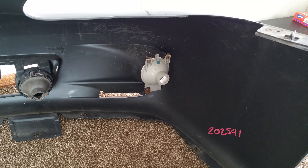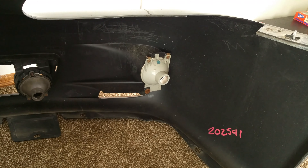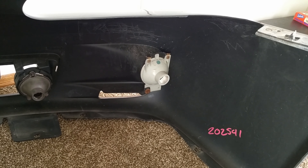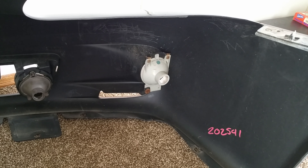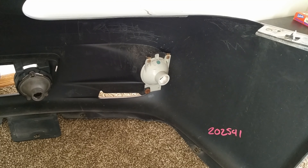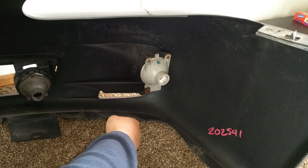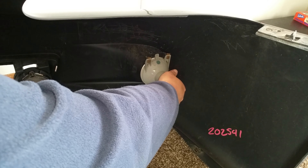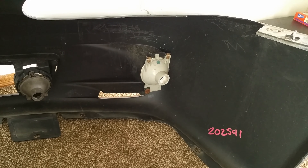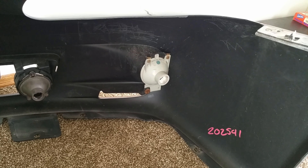What you're looking at is the inside of my front fascia — I already have it off, but that's not required. What you can do is remove your headlamp assembly, which is right about in this area here, and then you can just reach down and unscrew the bolts that are holding the housing in place. That's actually the easiest way to do it. Obviously you have a bulb in here — I have aftermarket LEDs. Once you get your headlamp assembly out, just take the bulb, twist it counterclockwise, and pull it out.